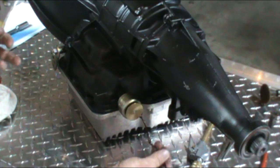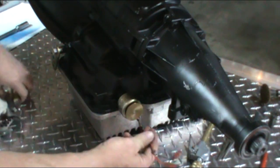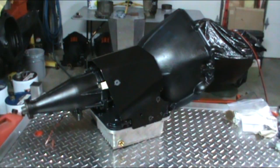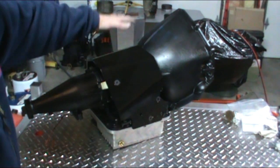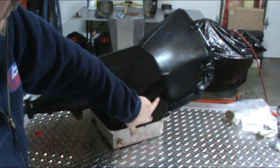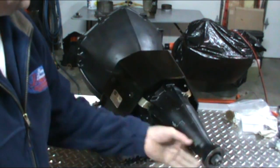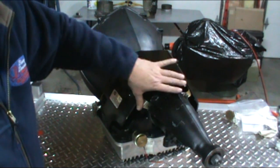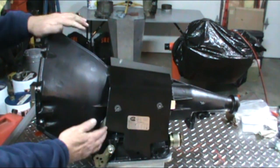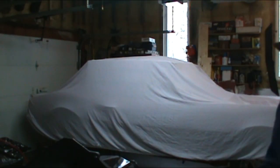Okay, another thing we have to get put on: we want to get our spool valve put in. Make sure it works nice and free in there. Just put a little bit of oil on the spool valve before you put it in. Then we can go ahead and get our trans brake solenoid installed. There's a small gasket that goes here — I've just stuck it on with some RTV. Go ahead and screw in the solenoid. There are two different types of solenoids — one might only have one wire, meaning it's grounding through the case. I kind of like the two-wire ones because then you know you've got a good ground, especially when you're dealing with aluminum. Okay, I've gone ahead and installed the safety shield — just in case there's an explosion, this stops everything from flying around. Two bolts screwed into the servo, and you have some brackets that go into the extension housing on each side. They do take some fitting — these brackets are not perfect, so when you get them you might have to bend them a little bit. And then there's one bracket up in the front that attaches to the front of the bell housing at the bottom.